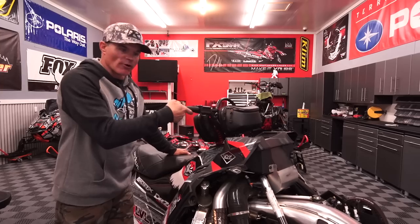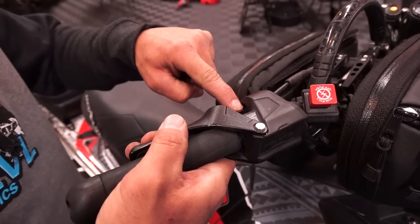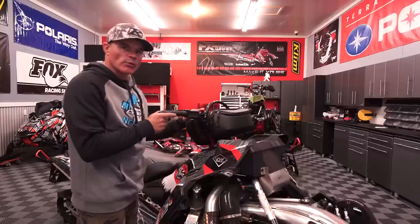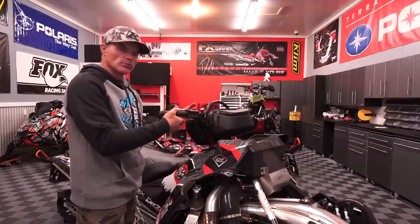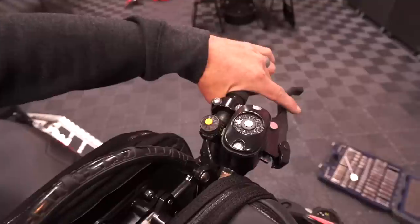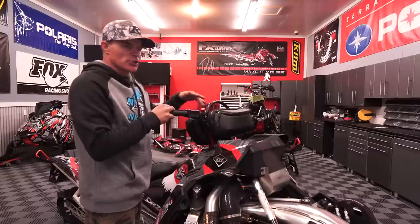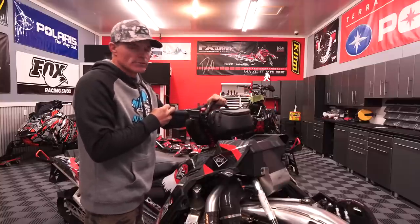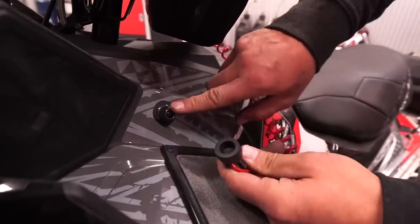Since your handlebars are where you control the snowmobile from, a great pre-season check is to check your throttle cable specifically. Feeling the throttle, doing a visual inspection, and making sure there are no kinks or funny spots as you grab the throttle. Now would be the time to replace it if necessary. Also making sure tension is correct against your throttle block — I've seen that cause issues when it's too loose or too tight. Check that your kill switch functions, look for loose wiring, and check brake pressure. Something may have bled off or introduced a bubble over the summer. Also check your tether — fire up the sled, pull the tether, and make sure there's no wear in the plunger.